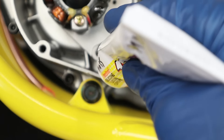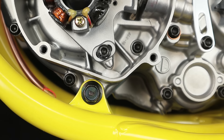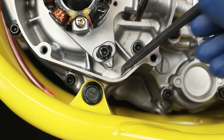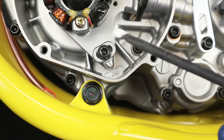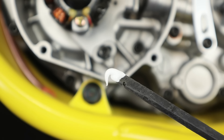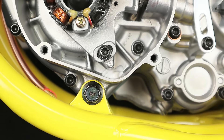I know it's a little blurry — I apologize. Load that bad boy up, and there she is with the old drippy tip — not good. I'm going to use this spudger, which is a cool little plastic pencil-type thing for scraping gaskets so you don't mar your cases, to try and wipe or press more of that 1211 down into the case. We're also using gravity with the bike on its side to get it to weep into that hole while it's still pliable.